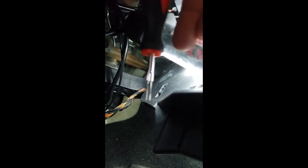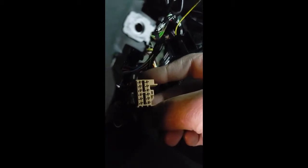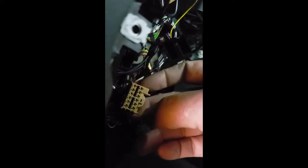Use this electrical connector removal tool. You slide the two pins on either side — you can see the two holes on either side of the main connector. Take it into C12, right here, slide it up in there, and the wire pulls out. Then put it right back into B4. There's no removal of anything — it goes right next to the purple wire again.